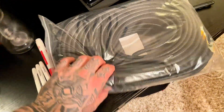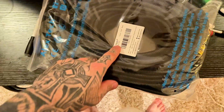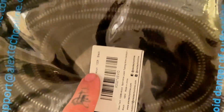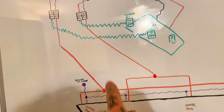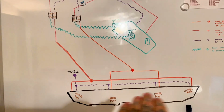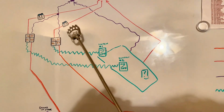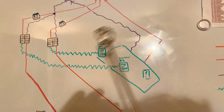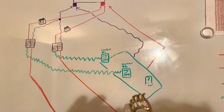Okay, and also I picked up some wire loom. I would recommend getting this one, 1/4 inch, 100 feet, because these 2 wires are going to be long, starting at the back end of your truck. Just some clarification: at least if you're not gonna run a relay, you definitely want to have an inline fuse so nothing burns up. Always run fuses on your stuff.